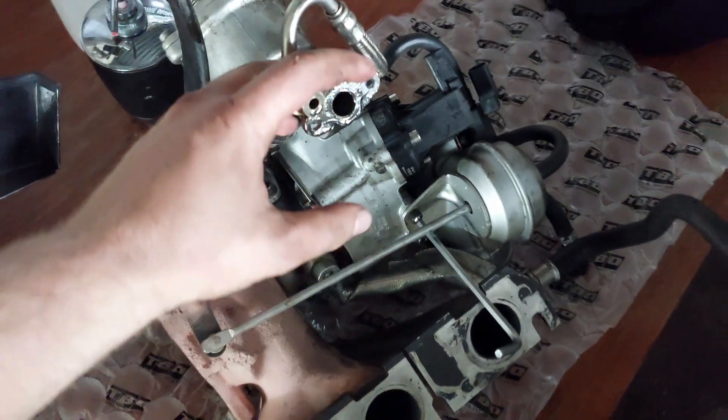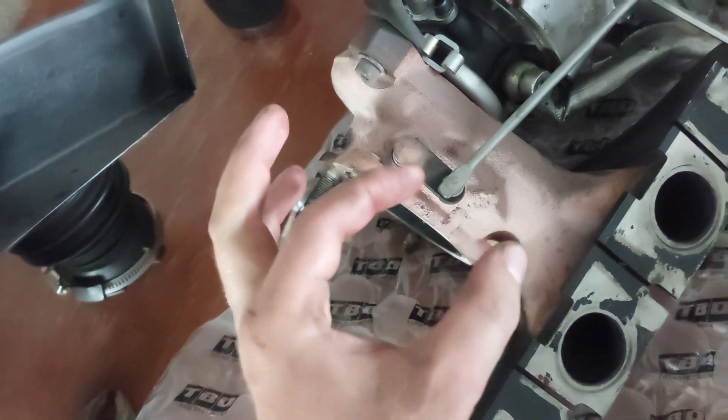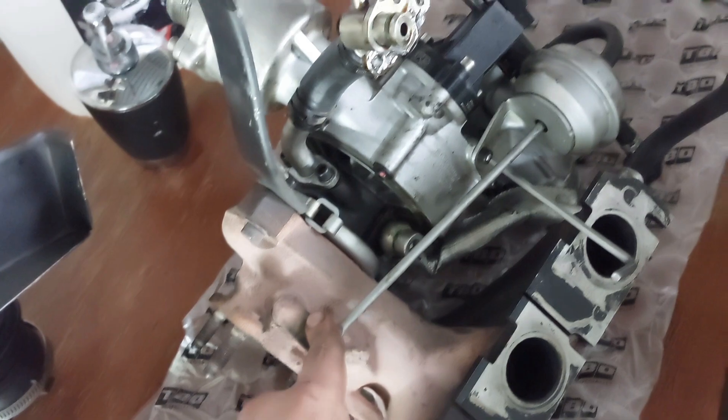The turbo is out of the car. I'm going to show you how to install the new wastegate — it's actually not too difficult. Right over here there are two bolts, so it's a five millimeter allen key. Then if you follow through on the other side it will be difficult to see, but once I remove it you'll see it's basically just a clip that clips in, so you're just going to take a flat screwdriver and push it out. Very simple.